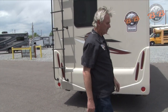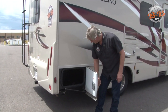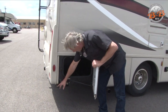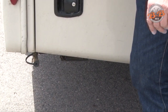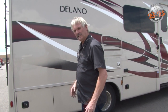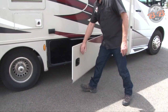There is a ladder on the back, but this is for emergency use only — do not get up on top unless you have an emergency, as it's very slippery when wet. There's a small storage compartment here. Down here there's a quick-release gas connection, primarily for when someone buys the unit and wants to hook up an outside grill — but it must be an RV grill, not a typical household grill, because they have different regulators.